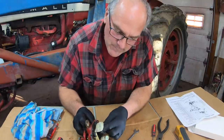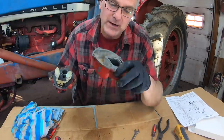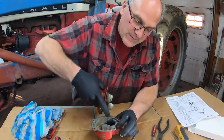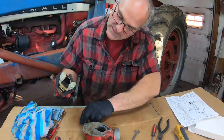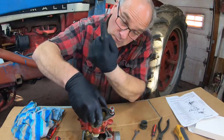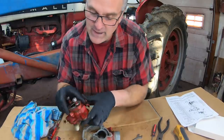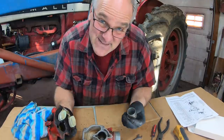Now we can attack this top part. This is the venturi, which is a kind of magical element of the carburetor. The fuel bowl is down here filled almost to the top, regulated by whether the needle valve opens and closes. Air comes into the carburetor past the choke butterfly and up through here. When you put the two pieces together, the air comes up through — that's why they call it an updraft carburetor, because the air comes up and into the engine, versus old car engines where it came down. The venturi effect creates negative pressure so that fuel is jetted into the airstream. That's pretty much how a carburetor works.